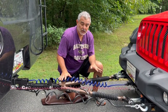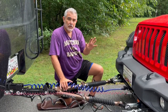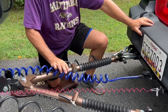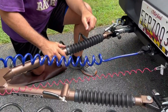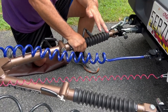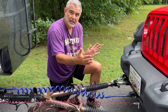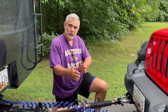Now that we have everything set up, the next step is we put our Jeep into neutral and then manually roll it backwards. We need at least one of these arms to lock into place — the arms have to be fully extended while towing. We just put it in neutral and I can literally just push it and it'll roll. With Blue Ox tow bars, only one of the bars has to lock to be able to start towing. Once one bar locks, I'll drive ahead 50 or 100 feet, Susan will walk alongside and she'll hear the second bar click — you'll hear it go click, click.